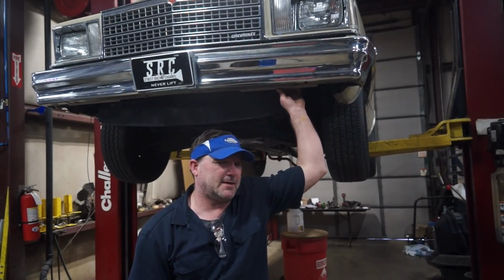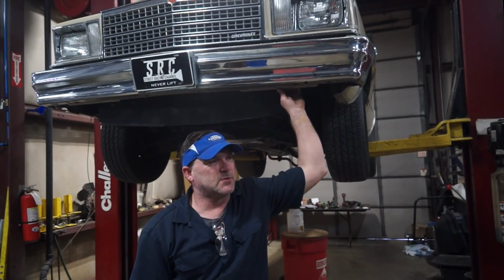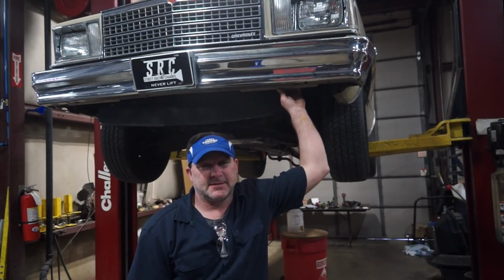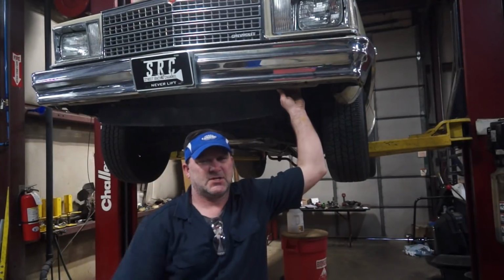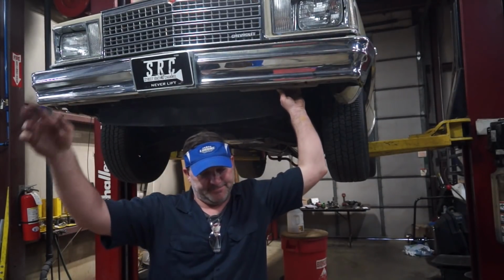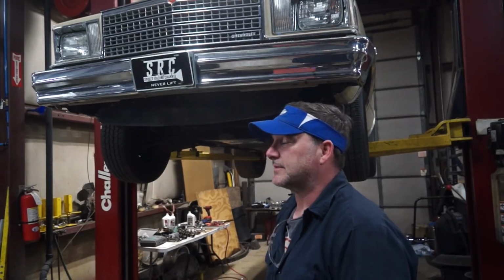Then the bolts for the bolt cover need to go in deeper, so I'm gonna have to pick up a bottoming tap to finish tapping those holes. Of course, I left the axles out reassembling it. That's just a bonehead move because I'm trying to film and talk and explain and whatnot. So that's on me. It's all right. I make mistakes too. It's okay to make mistakes. You just have to find them and fix them before you send them out the door.